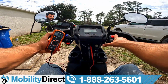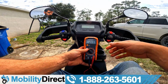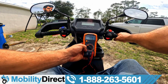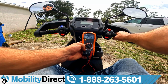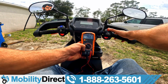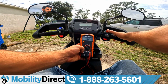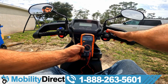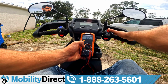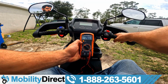But what I want to do is make sure that as I'm riding, that stays consistent at around 26, or close to 26, maybe a little bit lower than 26 as I'm going. If it starts to drop down to 24, that's why it's losing power and turning off. That means your batteries aren't able to hold a charge under a load, meaning when it's moving. So at 26.5 stationary, that's great. That's enough power. But let's see what happens when I start moving forward.